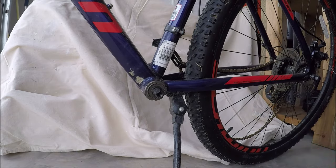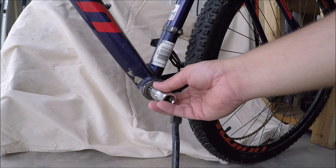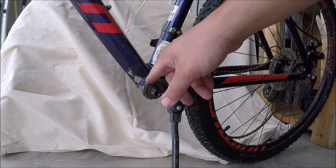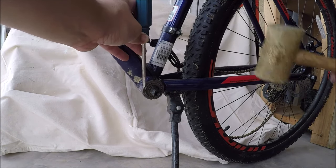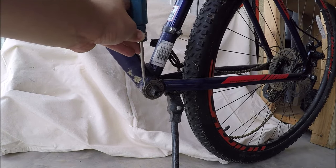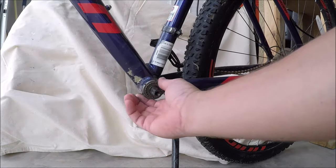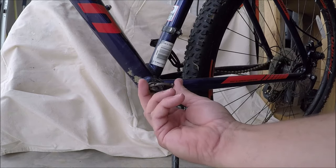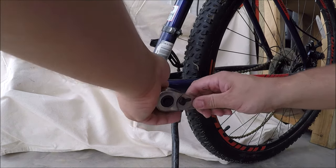From this point, I'll take our specialized socket — and you see all these teeth right in here — our specialized socket meshes in with those. Now that our crank arm is off, I'm going to take off this outer threaded portion here. I'll just get a screwdriver — there is a wrench but it doesn't come in this kit — and I'm going to unscrew this lock ring.